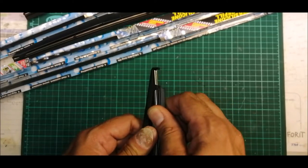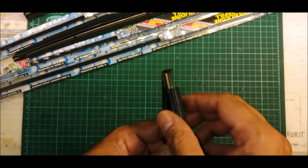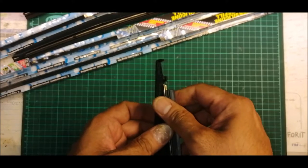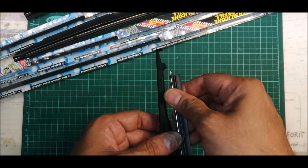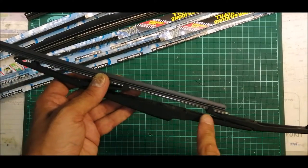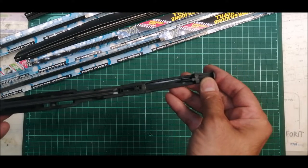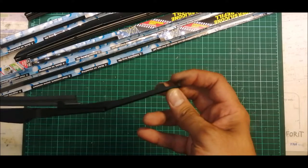You take out the rubber blade, and then there are two stainless steel plates. Just gently push and take them out. They are relatively sharp, so you want to be careful. Then you gently slide them out from their sitting positions. You can see there is a built-in stopper which you cannot remove, so don't apply any force, because this is a plastic material and this thing might break.